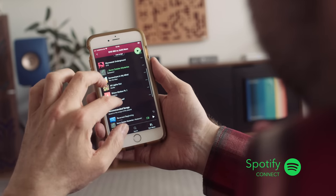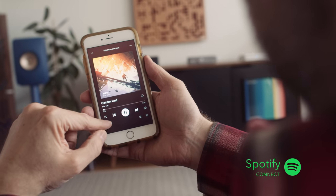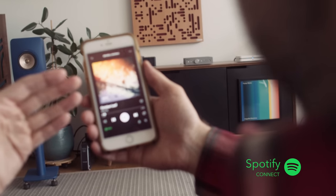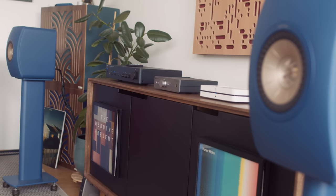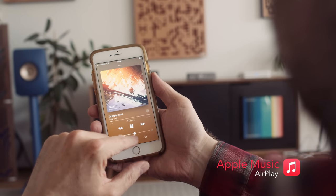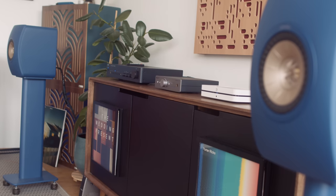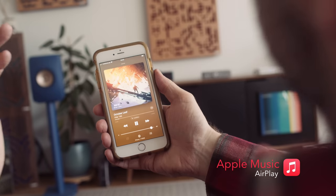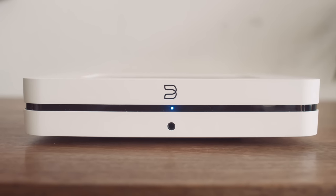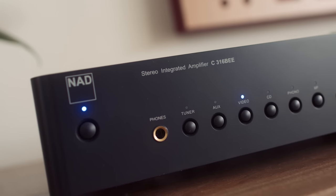iPhone, Spotify, with a playlist. I've already got it hooked into my node. Just down here is where we select it as the output device. I can bring it back to the phone — it sounds horrible — so send it back to the node. Spotify Connect in action. Now let's go to Apple Music. It starts on the phone. This is Apple Music, so we need to use AirPlay. We tap the AirPlay icon, select our node, and now we're sending the stream to the node. The stream comes from the Apple Music server, goes to the phone, which sends it via AirPlay to the node, which sends digital out using Toslink into the Cambridge DAC, converting it to analog, then through the amp and speakers.